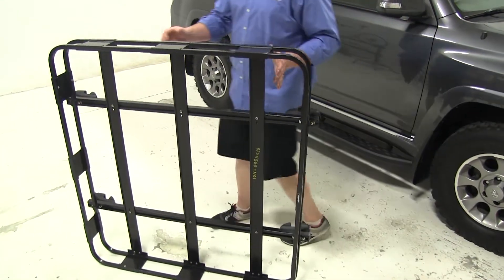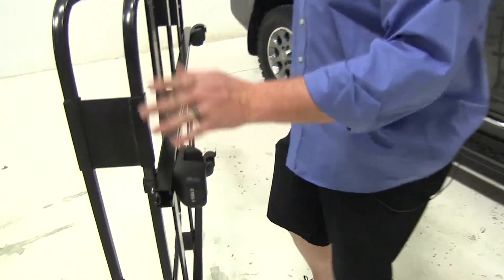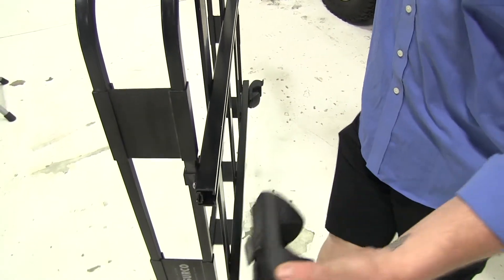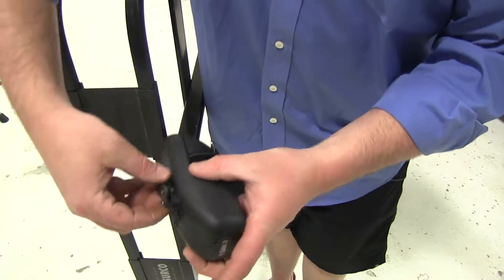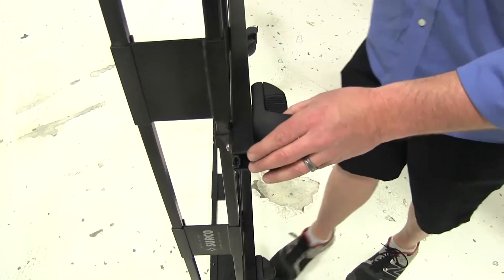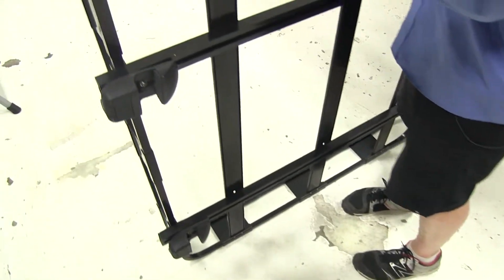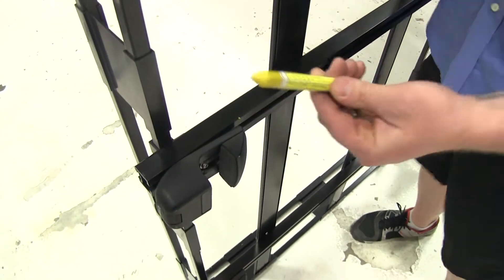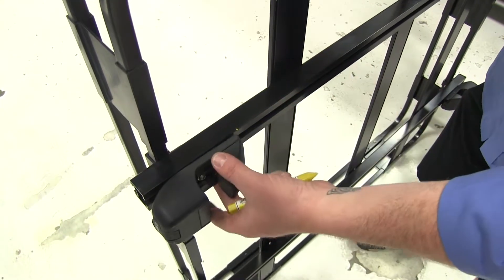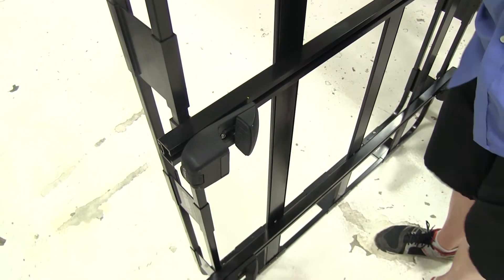First things with this rack — you're going to get it and you're going to have your feet separate, and you're going to need to lay the basket up on your rack to determine your crossbar spread. Then you'll slide your feet on like so and get them spaced out evenly across your vehicle. Once you get it spaced out evenly, we took just a regular lumber crayon — or you can use something else — to mark it, so that way when you pull it off the vehicle, you can tighten down your feet using a regular allen key.